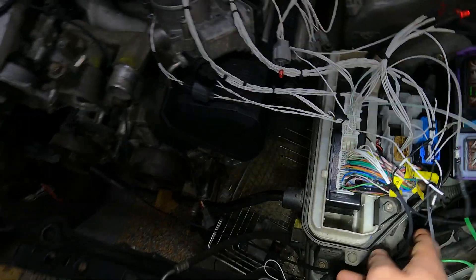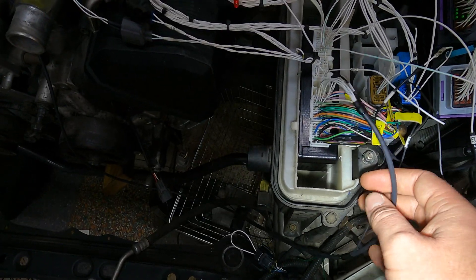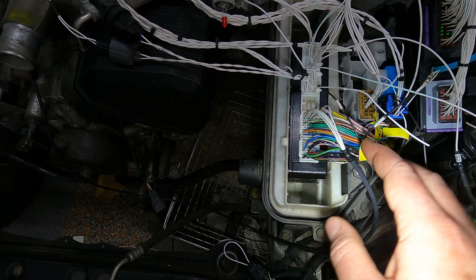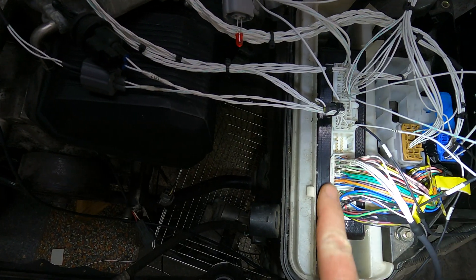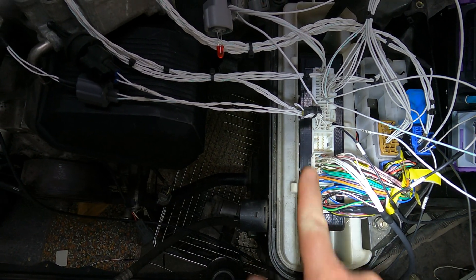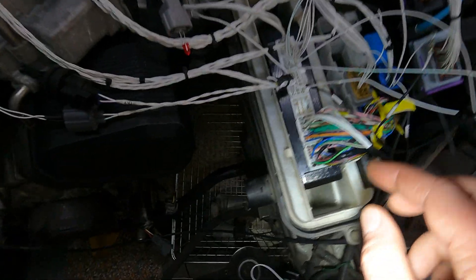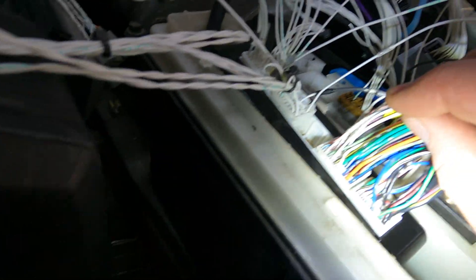This would normally sit down inside there, and you'll see we've got this excess harness over here — this one is for the wideband and temp. We've managed to get these all into the body plugs here; there are unused pins in there and we've allocated them so we can have an expansion harness. In this particular case we've labeled them as to where they go — this one over here is labeled 28/25, meaning 28-pin plug pin 25.